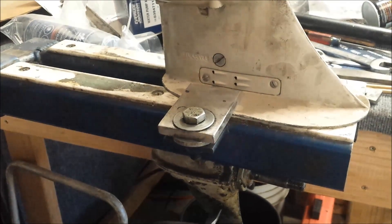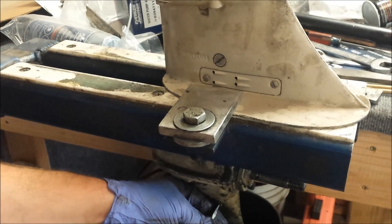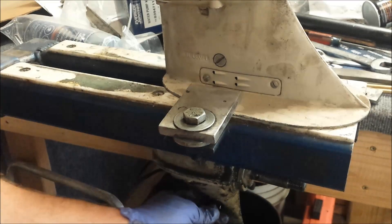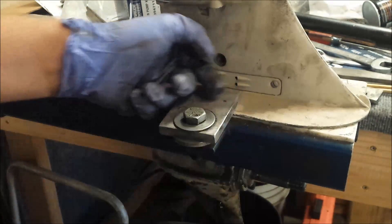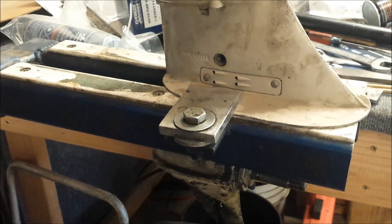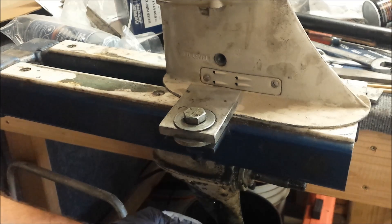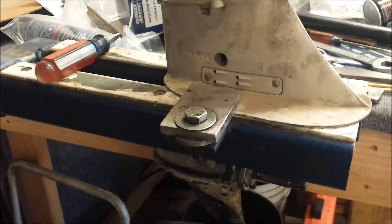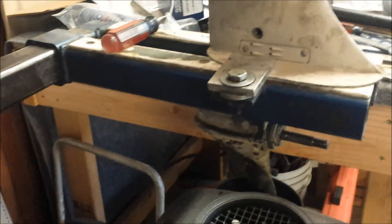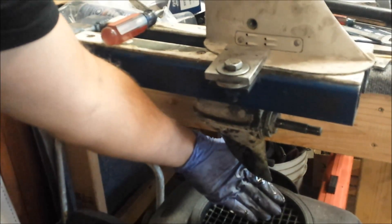I have the lower unit on the holding fixture - I already broke these bolts loose, then put them on. So I'm going to drain the oil and let it sit here for a while, make sure it all gets out of there. This will also give you an idea of what it looks like before any work's done. Not too bad - it's not clumping out of there, but it's not exactly draining quickly either. It's milky. I don't feel any metal shavings, but chances are the gears inside are okay - it just needs to be resealed.